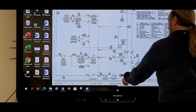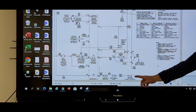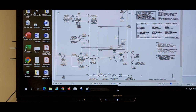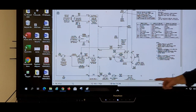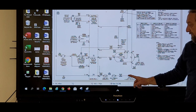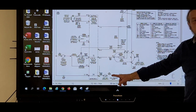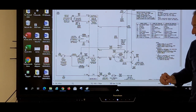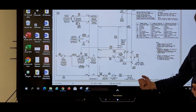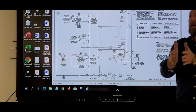You notice that the heater is still connected to the line one circuit, right? I can put my meter on either side of the heater to ground, and if I press start, I should get what? 120. And I can backtrack here, here, here. If I don't have 120, and I don't have 120, and I have 120 right here, that thermal limiter is bad. The limiter is bad because I don't have voltage coming out of the limiter, but I have voltage going into the limiter. So when you're testing, backtracking,